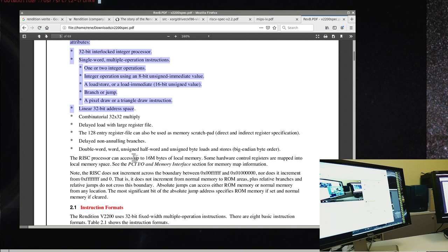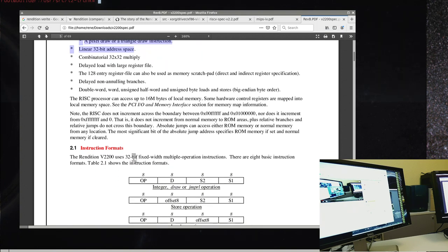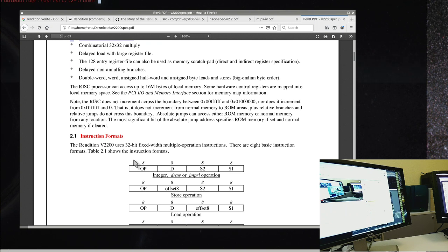And of course, this is running at 25 or so megahertz, or maybe later versions with 40 or 50 megahertz. It's not super amazing, extremely mega fast, but again, it is only the front end to drive an additional fixed function texture unit and such. So you only use this to do triangle setup or even maybe world transform theoretically. So it was, in my opinion, not a bad idea.